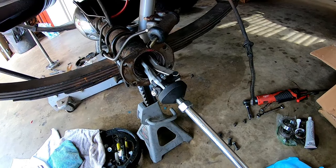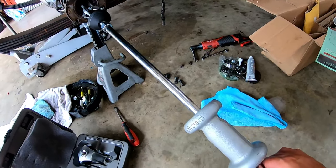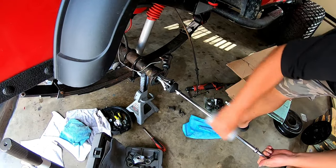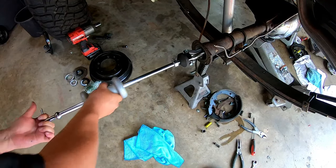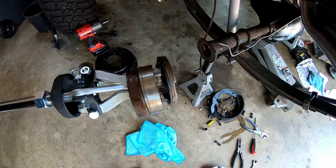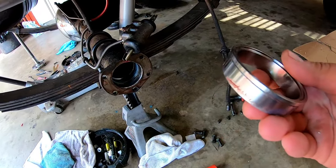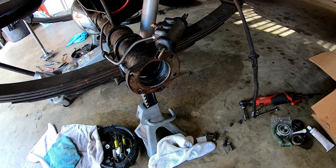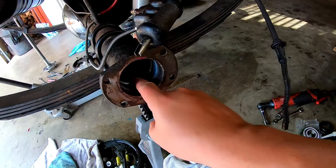To start the installation, I need to get the old seal and old spacer out of the axle housing. For that I'm using a Gear Wrench slide hammer. That kit makes short work of pulling seals and spacers. I'll put a link in the description — it's about 75 dollars on Amazon. Now that those are out, you can see where the seal rests and the two stepped areas where the spacer sits.